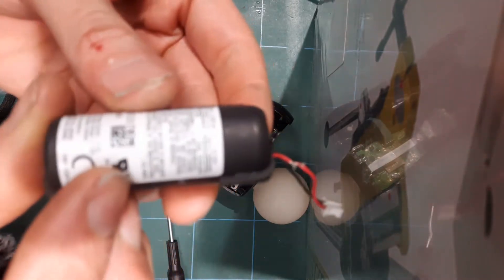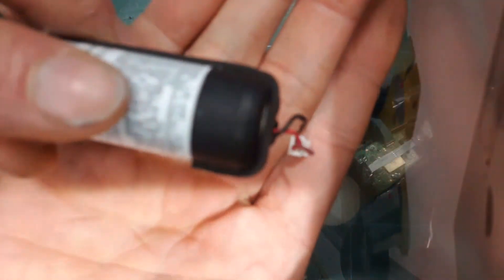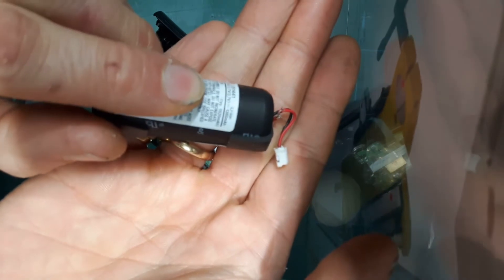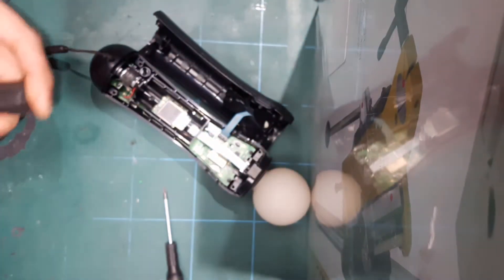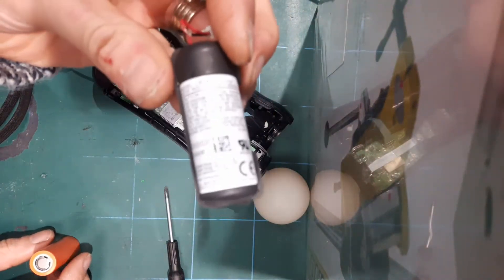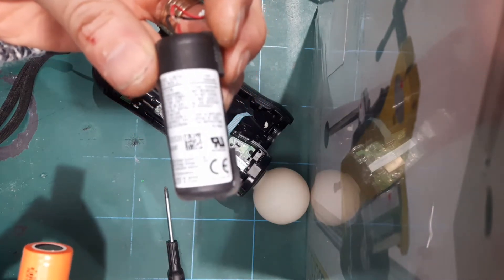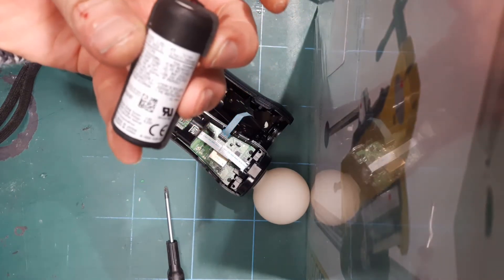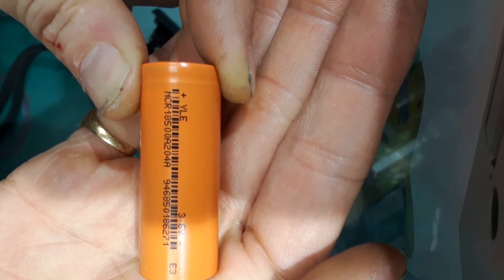And that is the original Sony battery. If you look on it, it should say its capacity. Struggling to get it to focus — there we go: 1380 milliamp hours. So this battery is actually a particular battery size type. Just like you have double-A and triple-A, this is actually an 18500 battery — that's an actual battery size designation.